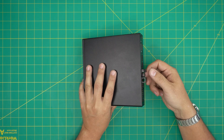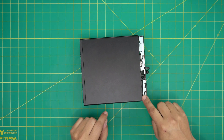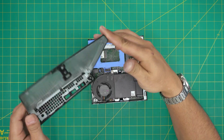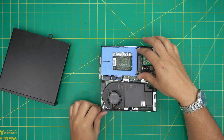First, loosen the screw on the back so it's just dangling loose. Grab the top cover and push it towards the front — you want to see a gap opening about one centimeter. Then pull the top cover upward and set it to one side.